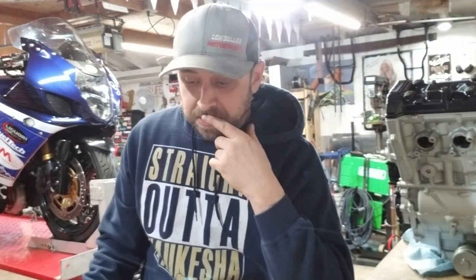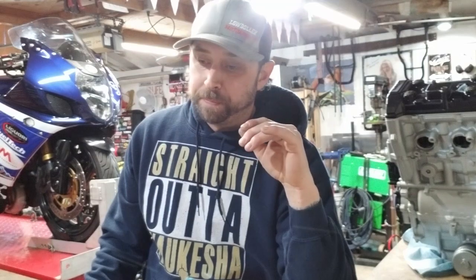One of the other questions I got recently, after seeing a lot of the videos I've been doing about all the cylinder head work, I'm salvaging this head, is whether or not to have a head surfaced. I got mixed feelings on having heads surfaced because, one, this motorcycle stuff that we do isn't like the car world. There's not a lot of excess meat on these heads to start taking a lot of material off. And if you take too much off, you're actually going to start getting into the exhaust seats. Not the worst. You can nip the top edge of them just a little bit, but I'd like to stay away from that if possible. So I don't really send the heads out to get them surfaced.